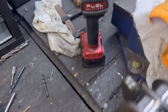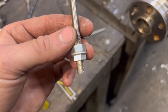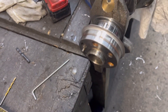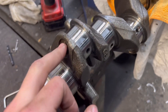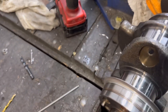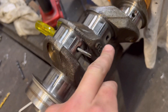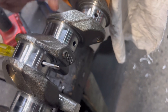I've already done some practice ones on my spare crank because I didn't want to stuff this one up. I did get a slightly oversized grub screw but I don't think it'll matter since it's getting balanced anyway. Just need to drill it out about half a mil. One important tip: be careful not to center punch straight through. The best thing to do is get a small screwdriver and chuck it through one of the oil holes to stop the bung from going too far down, because if it moves and you push it past the gallery you're pretty much screwed - no way to get it out without a really long drill bit.